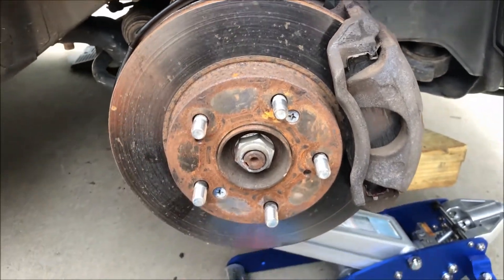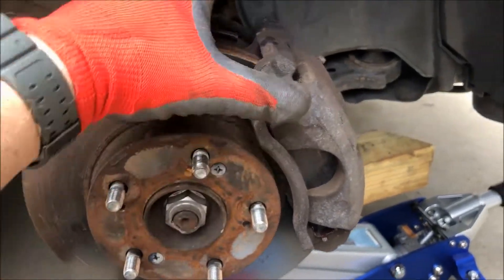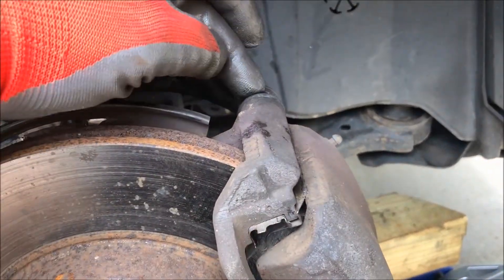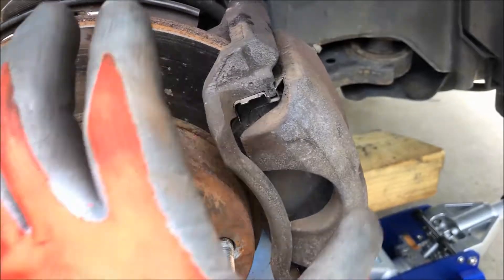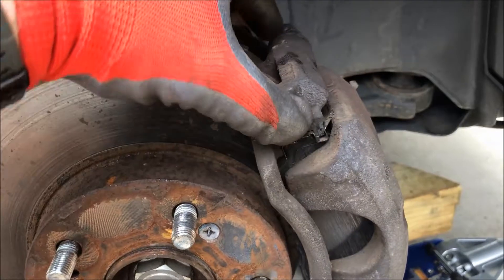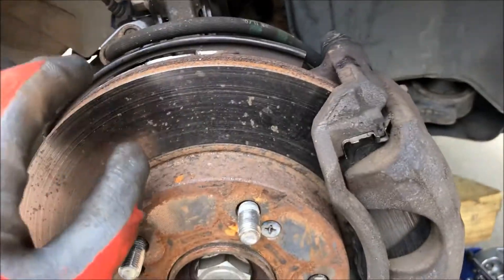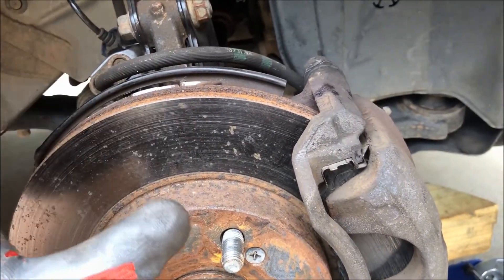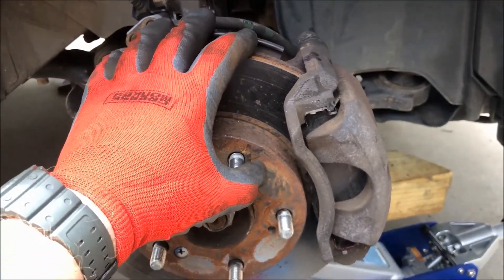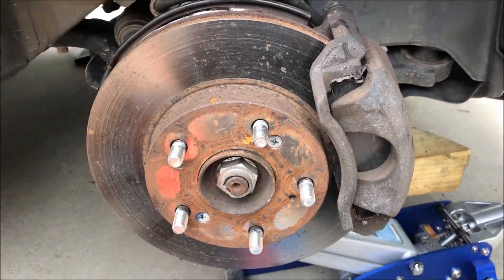This is why you see so much brake cleaner being sold in auto parts stores. You need to clean these brakes thoroughly, especially the pins, every brake change. I've found this to be a problem in a lot of cars I've worked on — if those pins aren't clean, the caliper will not float and will end up binding. On one of my own cars, dirt caught in there between brake jobs wore the pad down at an angle and actually destroyed the rotor without me even knowing it. It's good to do some inspection from time to time. Thanks for watching — if you liked this, give me a thumbs up, please subscribe, and I'll see you next time on Driving Intelligence.